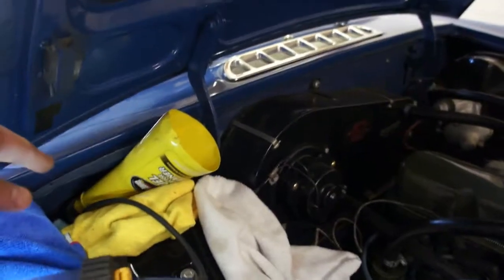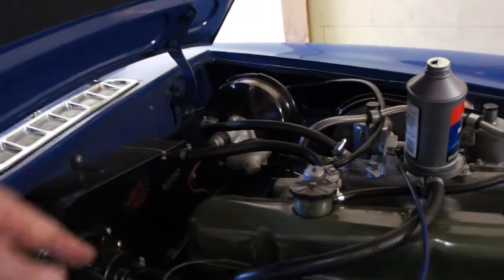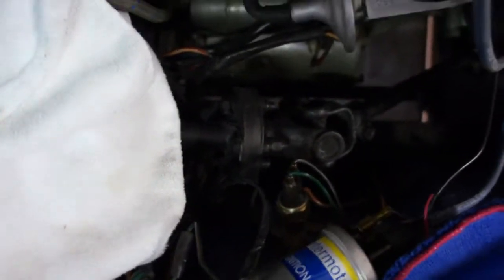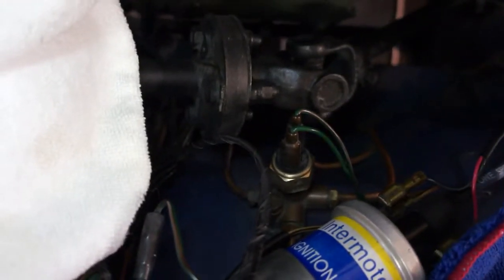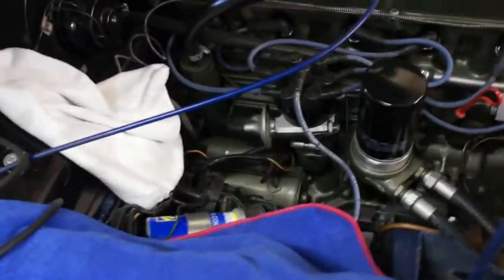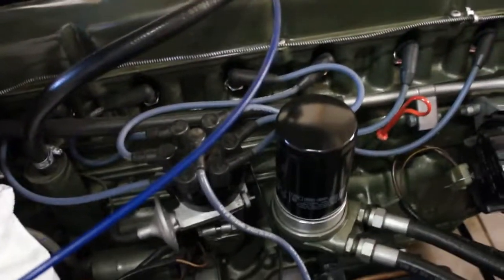In my situation I have a right-hand drive car. The brake master cylinder pumps out via one line into the servo, a servo return line into the splitter down here — right there, that might be hard to see. That pressure sensor also splits to the front, so one goes to the left front, the other one goes to the right front, and then one line goes to the rear and splits off at the rear.